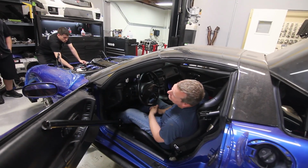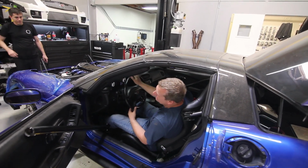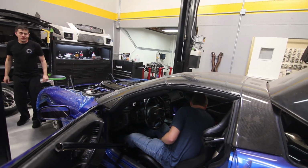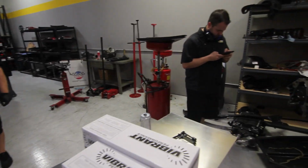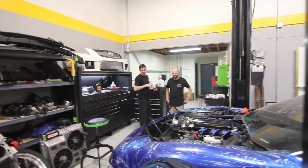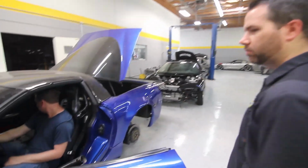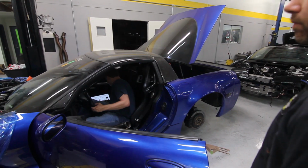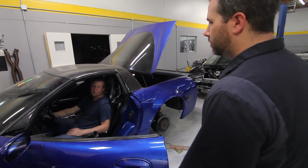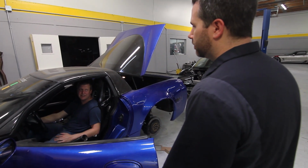That's enough because I can't see anything. So I need exhaust. The wideband isn't reading. Nothing's reading. Hey, Nick, are you getting nervous for your car? Nervous? No. It almost shot the vent line into the blower. We're hitting an idle airflow limit, which sucks. As far as how far open we can open the throttle blade, because it's a big motor, it needs a lot more airflow at idle than what your old motor did, and it's not able to do it.